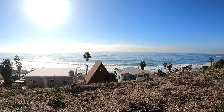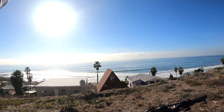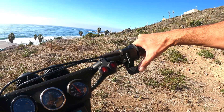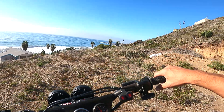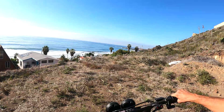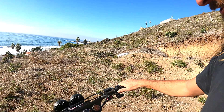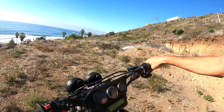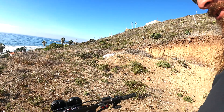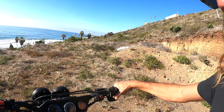One other thing I wanted to point out here — these are independent throttles. You have one for the front motor and one for the rear. What I realized is it's not so easy when you're scrambling up a hill to operate both of these and keep your grip tight when you're kind of just hanging on white-knuckle. Maybe I'll try and make a way to integrate those and put it on a switch so you have an all-wheel drive switch. It's hard to tell in the video but it definitely feels like it pulls up hills a lot better, though a little more out of control.